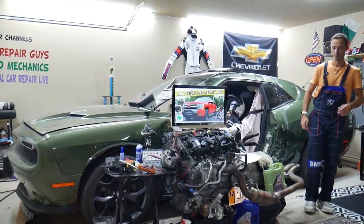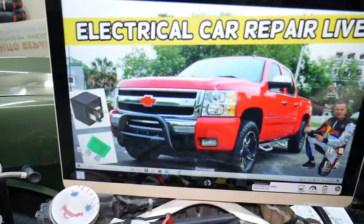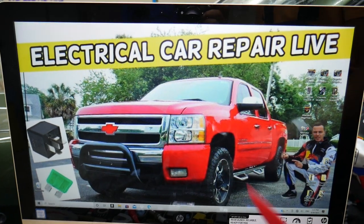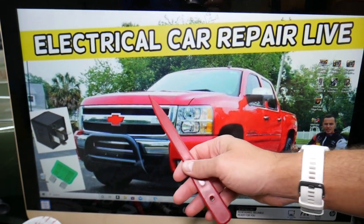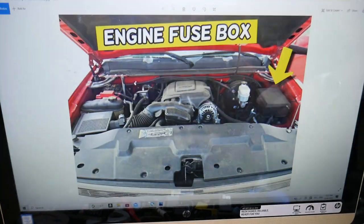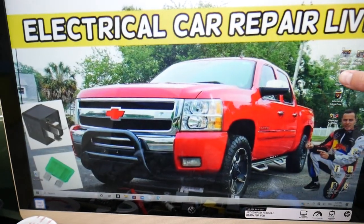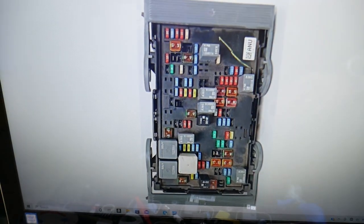What we have here specifically, we'll demonstrate on that generation Chevy Silverado. If there is no sound, here's what you need to check. You have multiple fuse boxes in that truck — actually, three of them. Today we'll work in just one, and that fuse box is under the hood. Go ahead and open the hood. Here on the driver's side, you have a fuse box under this cover. Open it and you'll see the main engine fuse box with a layout that will look just like this one right here.